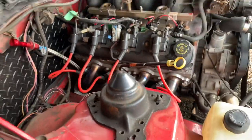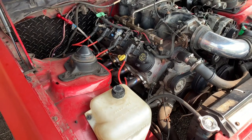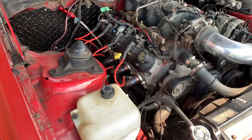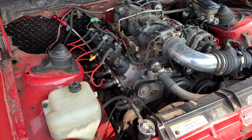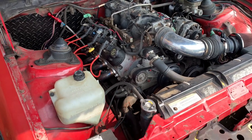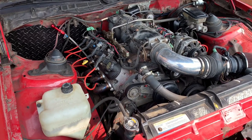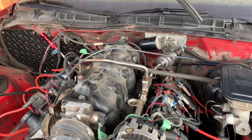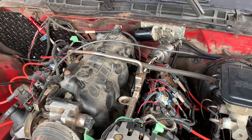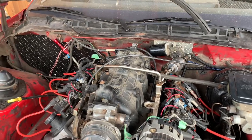No transmission — the dipstick's just bolted to the firewall. But the transmission is supposed to be back from the rebuilder this week, better than ever, with the shift kit and Corvette servo. So it's going to be the same 700R4 — same thing. That junkyard 700R4 lasted about a year, so I'm going to try it once more with the shift kit, see how it holds up. It was slipping shifting between second and third, so I'm hoping the shift kit and Corvette servo will help. I also found a wiper motor that fits between the truck intake and the Corvette fuel filter regulator — it's off a Dodge truck, true story.